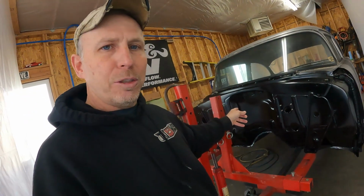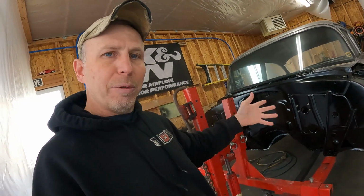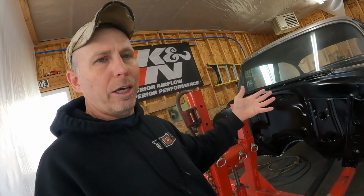So I was actually worried about the epoxy not covering the filler, because I've sprayed Summit brand epoxy and it was fine stuff, but when you're done, you could see the filler even after a couple coats. It's not a huge deal, because then you spray 2K on top of that to do your blocking. And this stuff is kind of the same situation. A lot of times you would spray something else on top of this, and then you would do blocking, and then you would seal it, and you're never going to see that. But in my situation, I'm leaving the SPI as the finished product. And that's fine, it's designed for that, and it's even designed to go over this filler, and if I would have known the right way to do it, I wouldn't have had this problem.